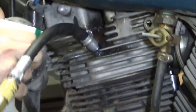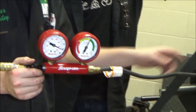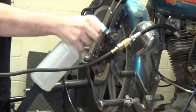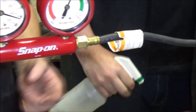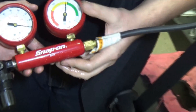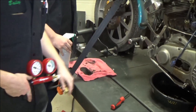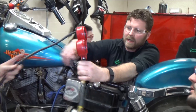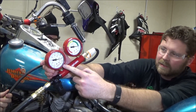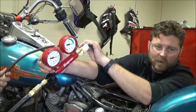Getting a few bubbles around that spark plug adapter? Sounds like it. So that's part of our leakage number. Go ahead and do the rest of the tool — do the coupler, do the pipe thread going out of the gauge, and do the gauge itself. The point is: our air comes in on this side — this is the amount of air we're supplying — and this is the outlet side showing what it will hold. Show the difference so we can see where it's actually leaking.